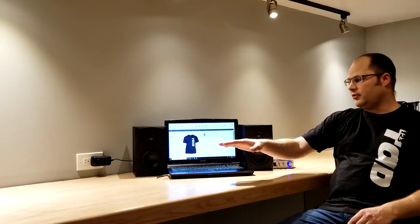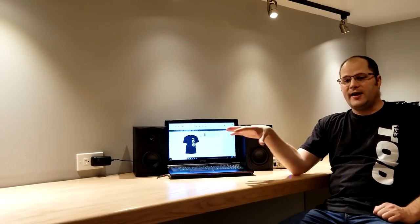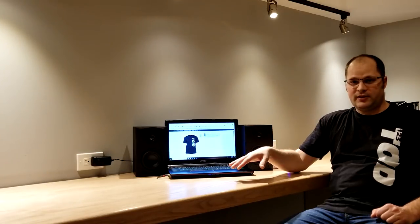The biggest reason is the way that they cross these speakers over, which is a first order on the woofer and a second order on the tweeter. The sound actually all encompasses you. And it basically sounds like the sound is coming all around you, almost like you have a mini surround system all around you. And that is just a really awesome way to experience your laptop or desktop. So if you're a big gamer, that's a great thing to have. Or if you like to watch movies and TV shows, these would be excellent to do. And of course, music, because who doesn't want to experience their music like that? So guys, I absolutely love these speakers. I would definitely give them my seal of approval.